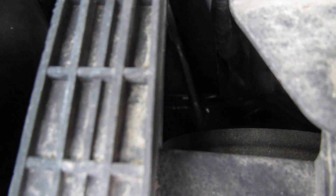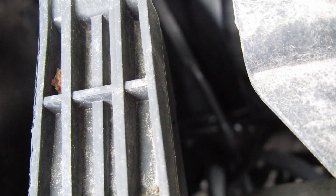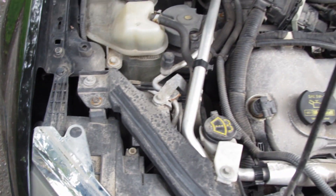That's the line that actually goes out to the washer nozzles. Just by looking at it originally, I could see the fluid was coming down from further up top, so it wasn't the pump and it wasn't the connection at the pump. I thought maybe there'd be a split line right here going in — that wasn't it either. So I followed the lines up top and there's a line down there with a little nick in it. That's how we diagnosed the issue.